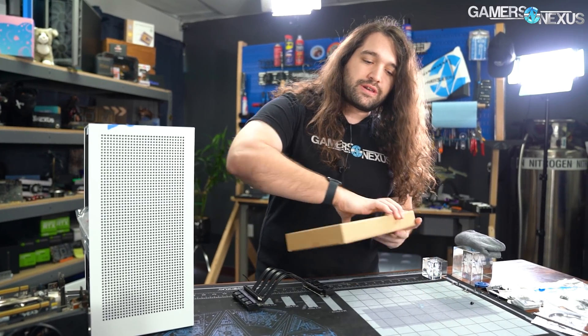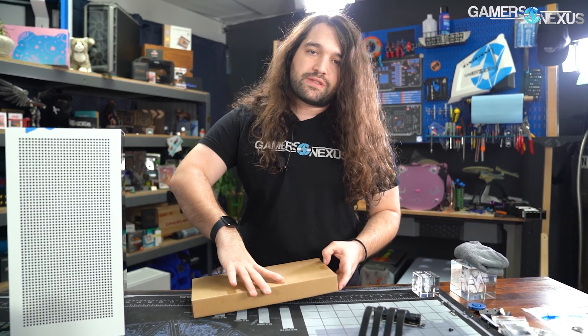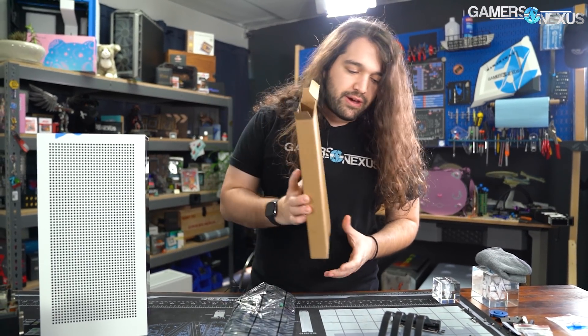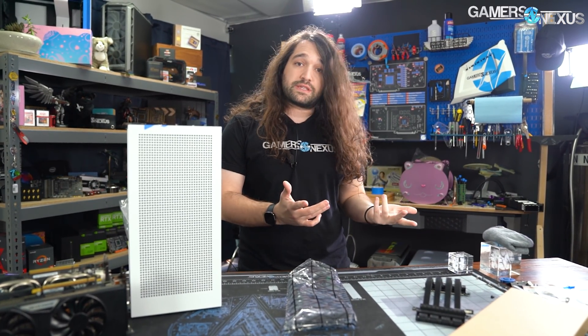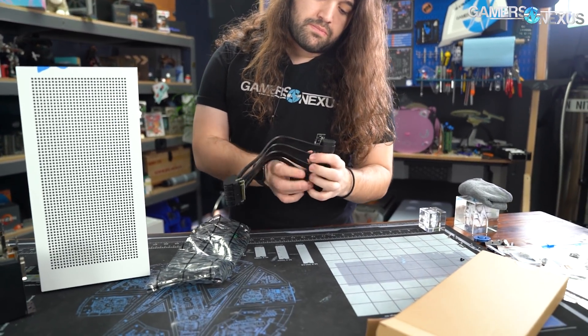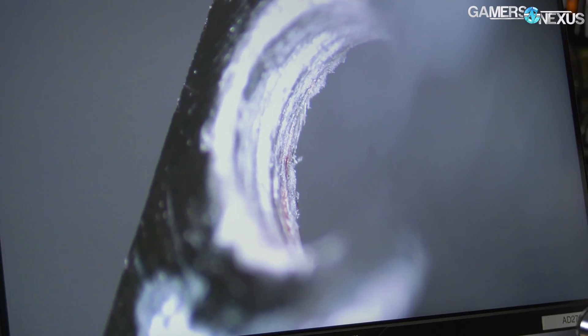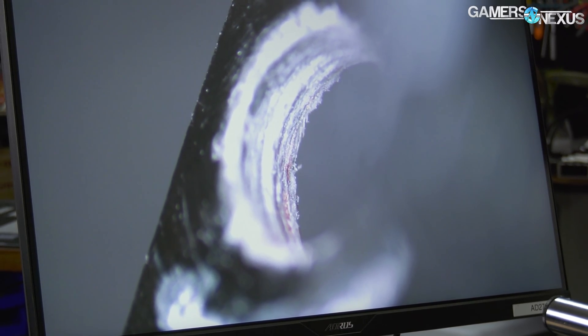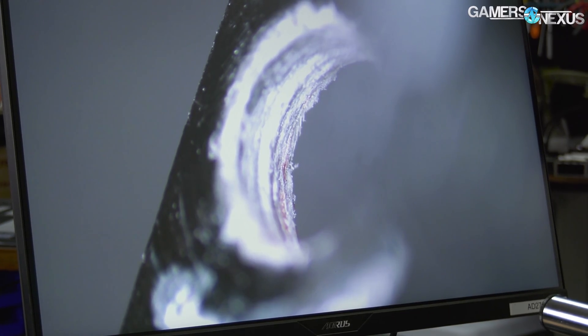I'll give the new cable a cursory visual look to identify changes, then pass to Patrick to analyze the PCIe riser. We'll use a digital multimeter to see if nothing is shorted, because that was a problem with our first one tested — 12 volts was shorted to ground immediately. We'll also test if socketing and unsocketing the PCIe riser affects the holes. Those through holes were previously unplated, and we have a microscope shot showing a 12-volt plane inside that would become exposed with screw cycles.